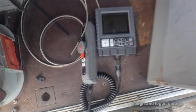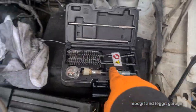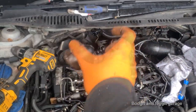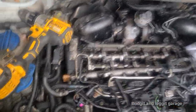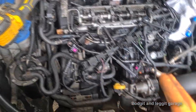We are back and have just cleaned all the injectors — showed you how to clean them in another video using the cleaning set from Hubby Tools. I'm doing it in separate videos so people can find just the cleaning content if that's what they want. All the copper washers are out, we've got brand new copper washers, and we've done the threads. Fingers crossed it's okay — still a bit unsure about that.